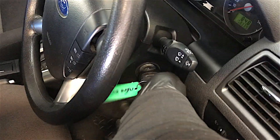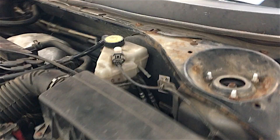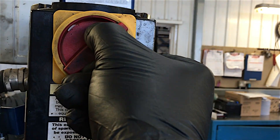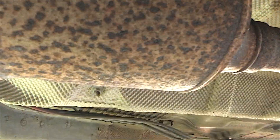But here's why. Underneath I could hear a rattling from the exhaust. I'm going to put the car up in the air because there were no other codes in the ECU, the coolant was okay, the engine oil was okay - everything looks okay around the top of the engine. The simple fact I heard a rattle on the exhaust makes me suspicious. Oh look - it's got a brand new downpipe on it, and this hasn't been long fitted.